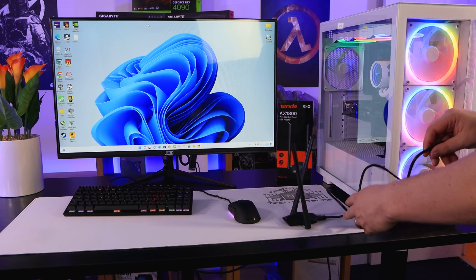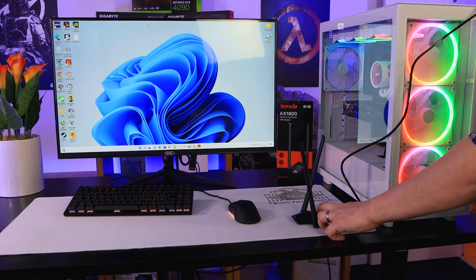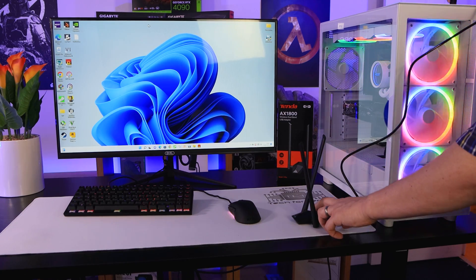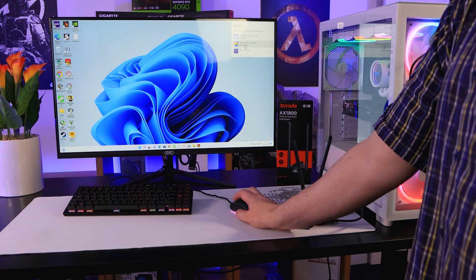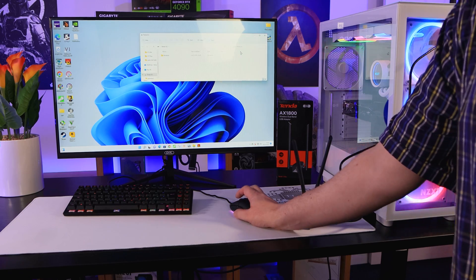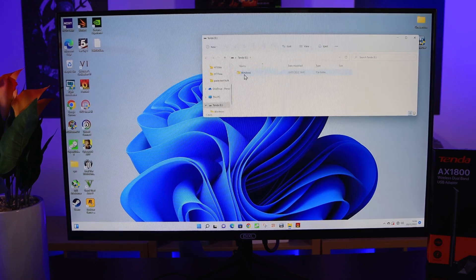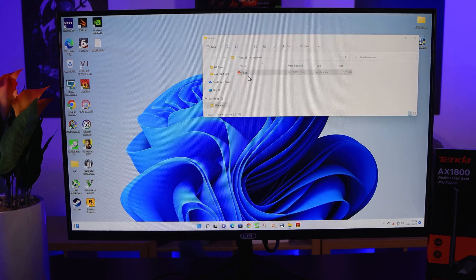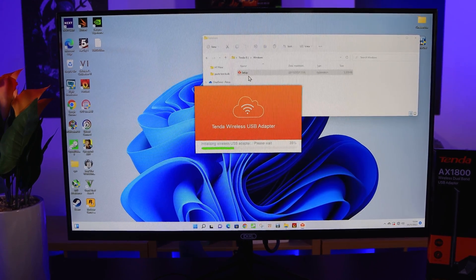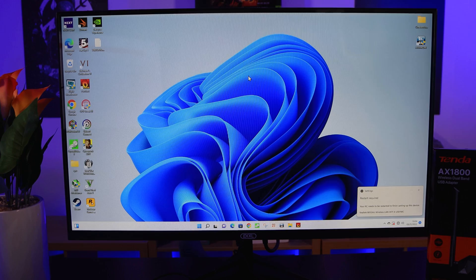As you can see, it does move around fairly easily — even on a mouse mat — because it doesn't have rubberised feet, so just bear that in mind. Plug it into a USB 3 port if you've got one. As you can see at the bottom of the screen, it's popped up saying autoplay. Click on it, then press Open Folder to View Files. Open the folder called Windows, then double-click the file that says Setup. Give it a few seconds and it should pop up. It says Installing — 40% in already — then 100%, and it recommends you restart the machine.